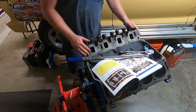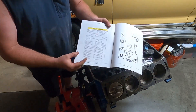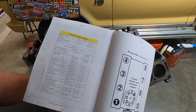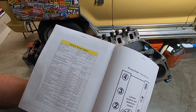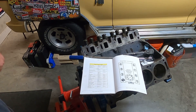All right, heads are on and torqued — went through the sequence. It's calling for anywhere between 90 and 110 foot-pounds, but everywhere I've read it's saying 95 foot-pounds, so that's close enough for a stock motor. There wasn't really any specific torque sequence to it, so as you saw: put them in finger tight, tighten them up a little bit, went over a little bit more, a little bit tighter. I actually got them right to 95 just with a half-inch ratchet, so if you don't have a torque wrench, just put a little bit of effort into that ratchet and you'll get it.